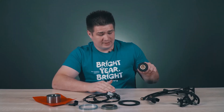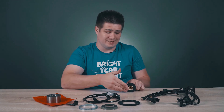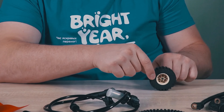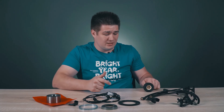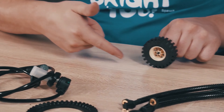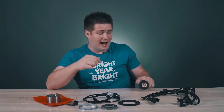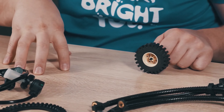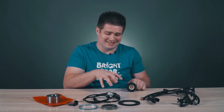Now a few words about the physics. On flat surfaces, braking where the wheel is fully stopped or blocked is actually worse than braking just up to the point of blocking without crossing it. When we brake in a locked state, the wheel seems to fly over the surface. But when the wheel brakes while grip is maintained, the tire clings to the surface and the coefficient of adhesion is greater, so the car brakes better.